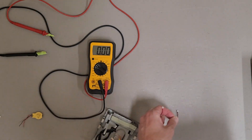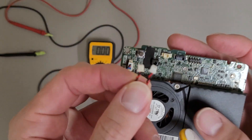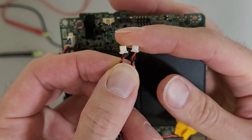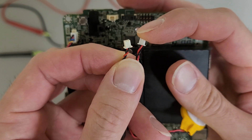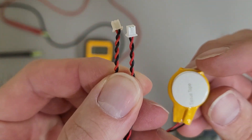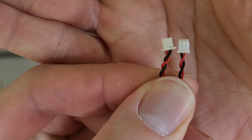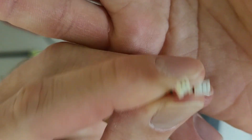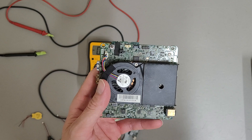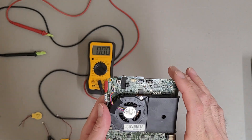There's an interesting quirk here with the CMOS battery for this Intel NUC — and it might be the same for others, but I can't speak for that. If you look closely, you'll notice the plug on the left of your screen is the original battery, and the plug on the right is the aftermarket new one. This isn't a battery I bought specifically for the NUC, it's just a common style of CMOS battery that lots of stuff uses. But you'll notice the wires are in different positions, even though the connectors are in the same position. Apparently, Intel decided to wire the CMOS battery connector opposite of how everyone else does it.